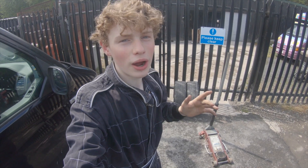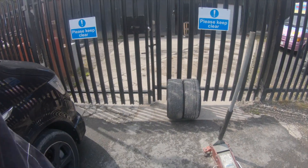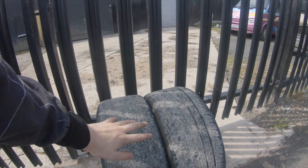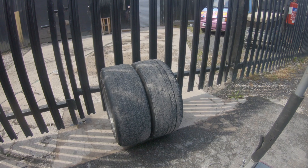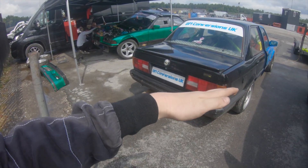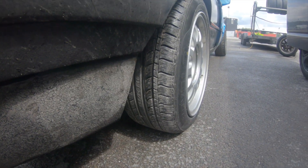So the track started quite slippery, then it got patchy, and now it's fully dry. The problem was I was on the same tyres and they had 20 psi in - pressures set for the wet. So I had loads and loads of grip, so I was literally clutch kicking every time on a transition, changing from one side to the other. Anyway, put a new fresh set of tyres on and let's go out and drag these.